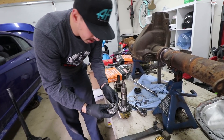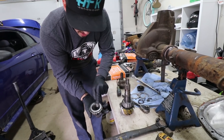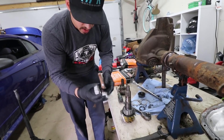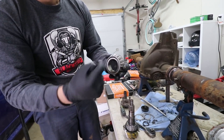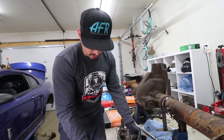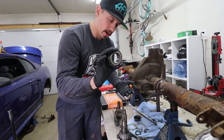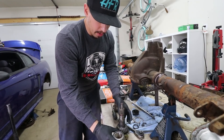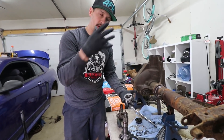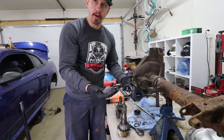But that does look like the same bearing to me. Can you not just check the number on the bearing? I can, but it's on the back side — on the underside of that bearing. So when I pull this one off, you can see that this one's actually ground out. This is our test bearing because in order to get the right pinion depth you actually have to put shims underneath this bearing. So what you do is you use a dummy bearing — the dummy bearing sits on top of the shims. That way when you bolt it all together and it's wrong, you can just slide this bearing back off instead of ruining a new bearing again.